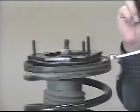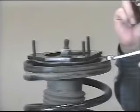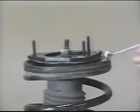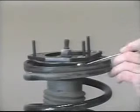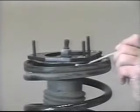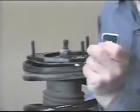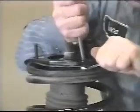A fast procedure to bolt the adjustable camber plate and the OE strut plate together is to place the self-locking nut into a 1/2 inch box end wrench. Drop the wrench through the opening between the strut plate and upper spring seat. Slide the wrench as far forward as possible, then rotate the wrench 90 degrees to the strut assembly. Use a pin punch to bring everything into alignment.